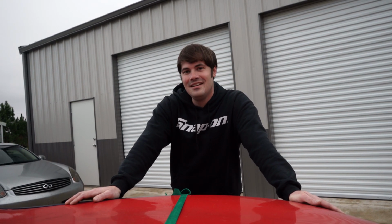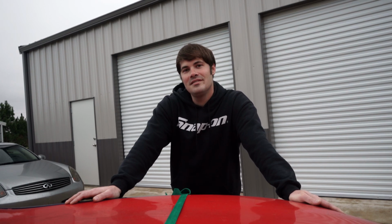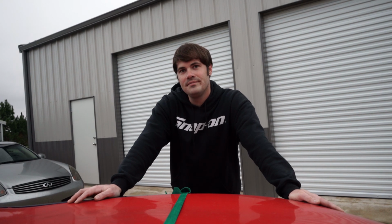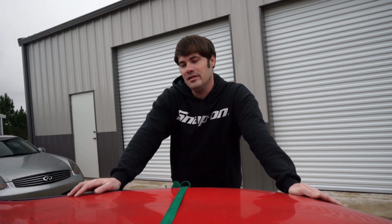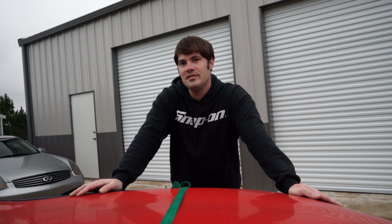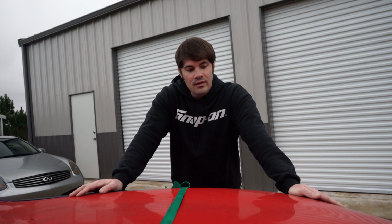So you got to take the S14 subframe off of this, and you're gonna put a. Yeah, we're just gonna stick the S13 subframe in it for the time being, because the car will still roll around. Okay. So it's not really right, but one of the rack clamp sizes is different. I can at least bolt the rack back in it and the car will roll around. That way it's not stuck on jack stands on the way here. Cool. But what are we doing right now?